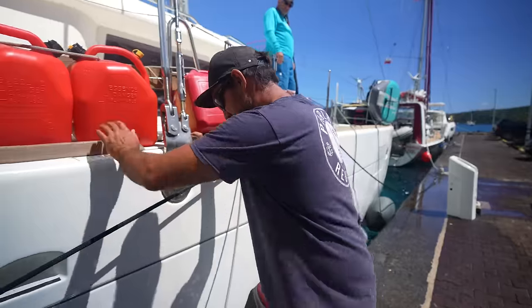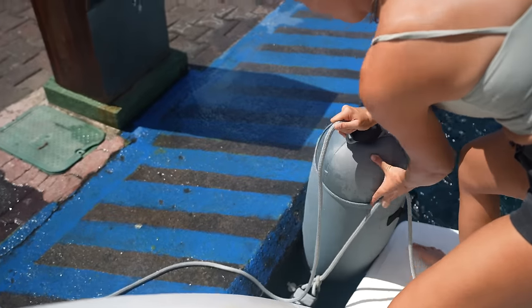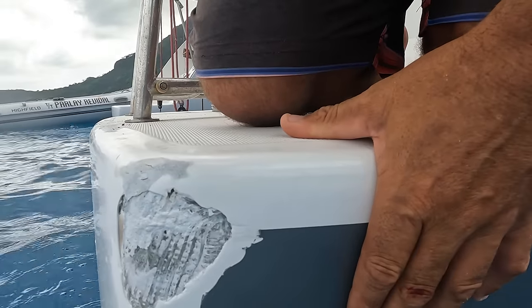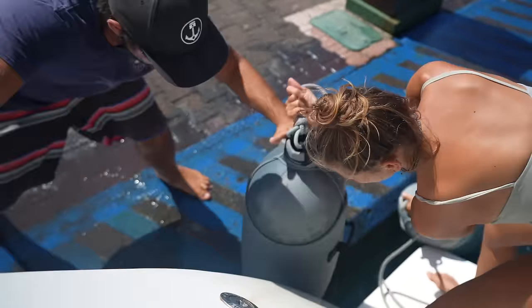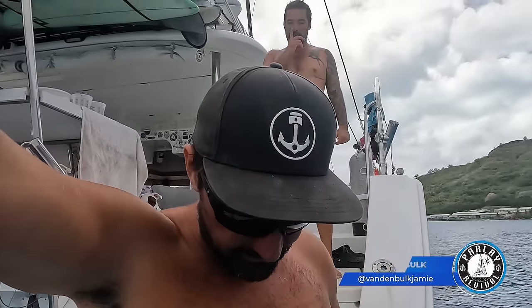This was definitely the freshest produce we'd seen in French Polynesia. But while we were shopping, the tide had risen and there was barely any dock left for our fenders, and the wind had picked up to 15 knots blowing directly onto the dock. We gave the dock a little love tap — a fender popped out, and the corner of the boat touched the dock and knocked some gel coat off. So I'm going to cut the tape back, sand it, and put some cover seal and gel coat in it to reshape and colour-match before we leave.